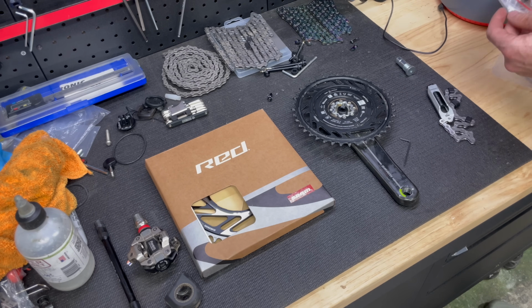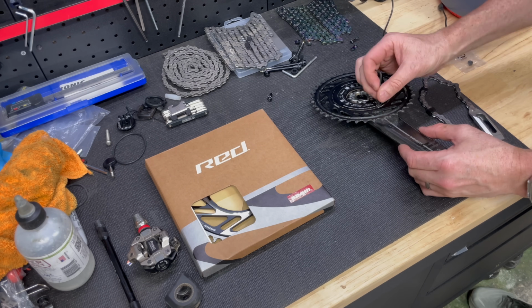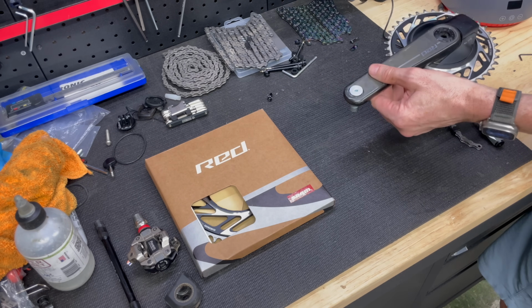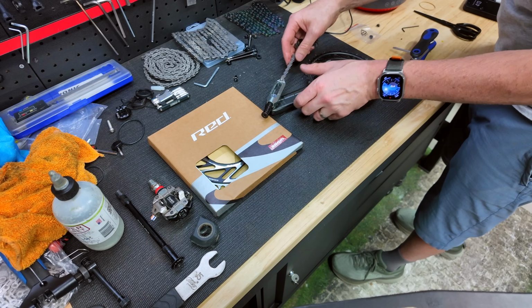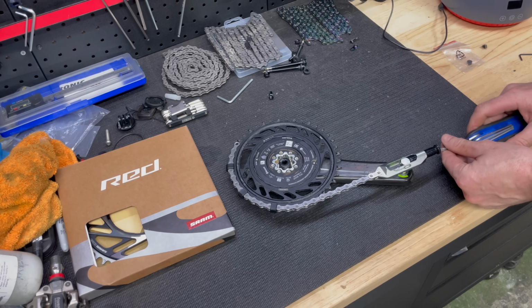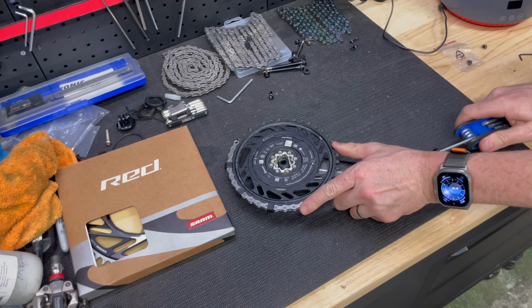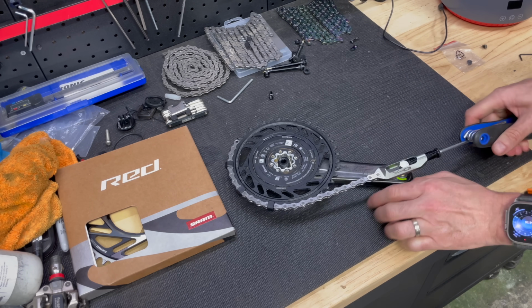Now to get the chainring swapped over from a 40 tooth to a 46 tooth, which would be more suitable for road riding, it's onto using the threaded chainring removal tool from SRAM. And the correct process there is to remove that little locking pin, install the anchoring bolt into the pedal thread, and I'll flip this over here, install the chain tool here. Now you could possibly do this, and as people have mentioned, maybe with a chain whip and a vise of some sort. But yeah, you can see here how delicate this operation is, and it ensures the teeth on the chainring are not compromised or bent in any way, and the chainrings aren't going into your wrists.